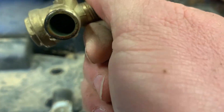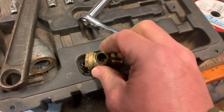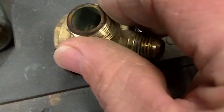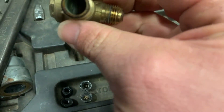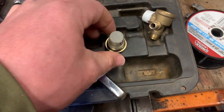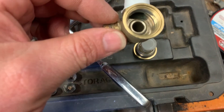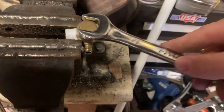Now, what are the chances we can find a part number on this? Doesn't look good. Oh — I think I see the issue. That thing in there, the valve inside, that looks like it's supposed to seal or something — it is cocked at an angle right in there. So that's probably the issue right there. Let's see if I can take this thing apart. So I finally managed to get this thing apart, cleaned it up really well, and I went ahead and stretched that spring just a little bit. I think it just got some trash in there and kind of lodged itself at an angle.